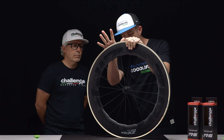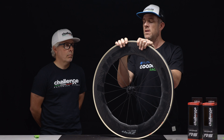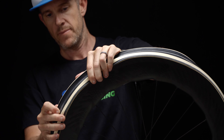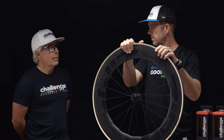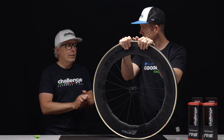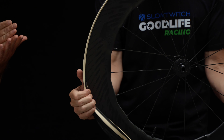To recap, it's a three-step process. Step one: get the tire around the entire rim flat. Step two: get one side of the tire in the middle of the rim — as demonstrated earlier, it's a pretty easy process to get that first bead on, so there's no need to muscle through it. Step three: get the other side on the actual inside of the rim.